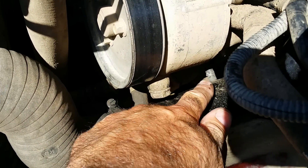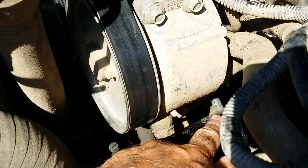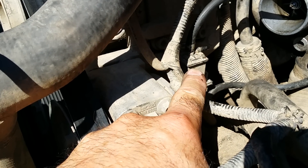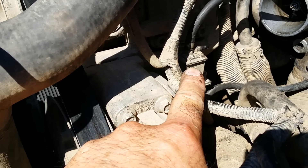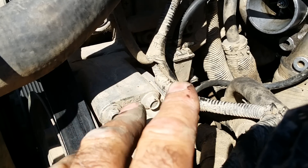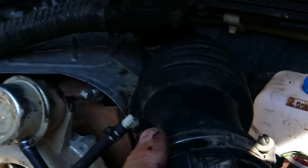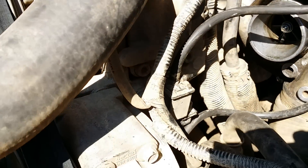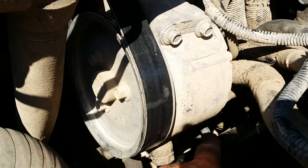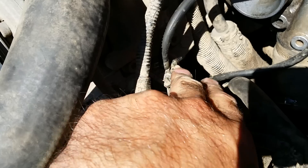On the metal part there's another connection — that's the pressure in. You can either change that valve, it costs about 20 quid, or — as our local 4x4 centre have said, having done a lot of these — the Defender hasn't got that valve. So what they said is just leave the plug on, leave that pipe onto the inlet side, disconnect the pipe down here, and join that pipe directly to the turbo. So basically you're bypassing that modulator, which is exactly what I've done with this nice big bit of pipe.